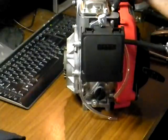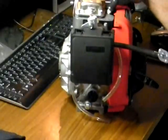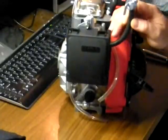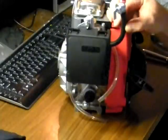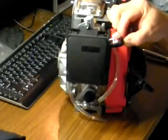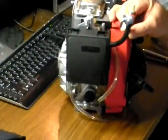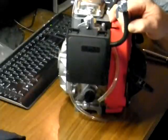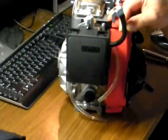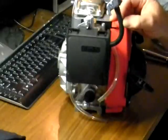This is a quick demonstration on how to clean and blow out your fuel filter system or carburetor. A lot of people don't understand that you need to install an inline fuel filter — not just on four-stroke engines, but every engine you install on a bicycle needs a fuel filter. Because a lot of people don't put them in, they end up with everything plugged up.